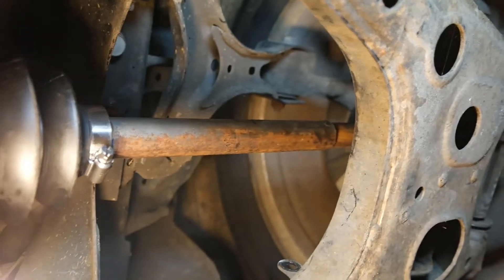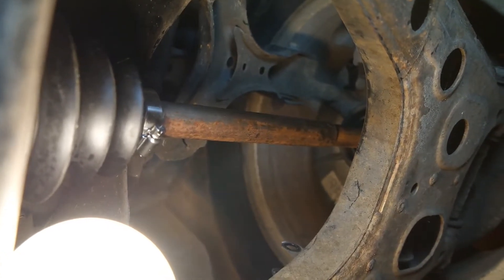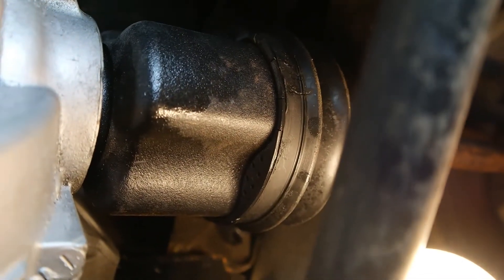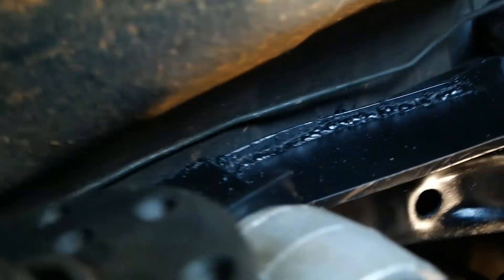I don't believe I'm going to have any problems with the travel. This came off a Ford Explorer, and obviously the amount of travel on that is a lot greater than on a Miata, so I think we'll be just fine with the shaft at about that length. I'm going to have to fix that in place, take it out and measure it. After I fix it in place, we'll manipulate the suspension and just make sure it doesn't bottom out. Got to be careful because it's just a hose clamp holding that on. When we take it out, we'll measure the depth of where that snap ring is going to ride on the inner tripod bearing and make sure it's still in the right spot.